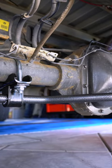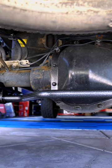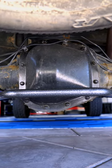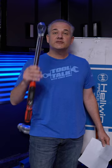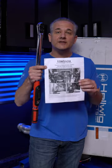Check for clearance to make sure no wires or hoses will be crushed. It's a good idea to have somebody bounce the rear end of the vehicle up and down while someone else looks underneath to ensure nothing's getting hit. Now the final step is to torque everything down per the torque specs of the installation instructions, and it's not a bad idea to check everything again after about a week of driving around.